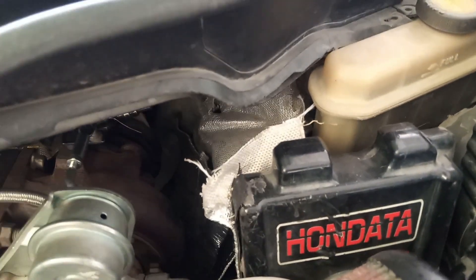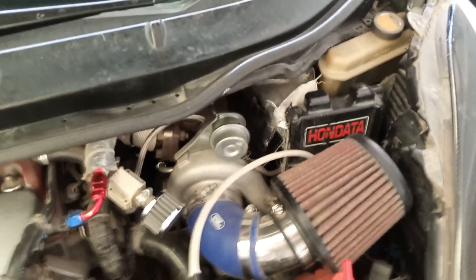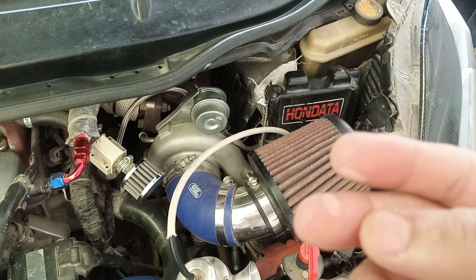If you are adjusting when the turbo is hot, please wear gloves — don't burn your hands like I did. But usually this is a one-time setting and then you just forget it. It's not something you adjust daily — you set the low and high boost and just control the boost from the toggle switch inside the cabin. I was adjusting a lot because I was tuning and experimenting.